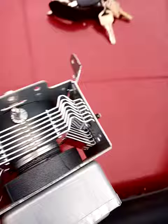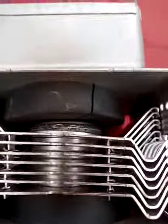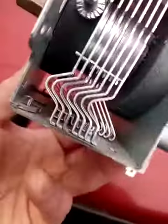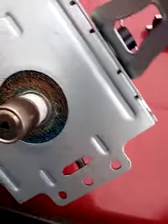But as you can see, it's cracked on the magnet on this side — they're pretty cracked. That one looks great, well actually there's a slight crack down in there too. Anyways, it's cracked, so that's the easy tell: before ever doing a multimeter test, just look down in there and see if those magnets are cracked.